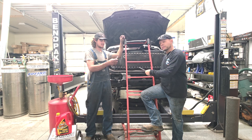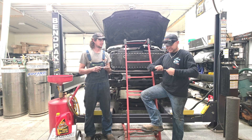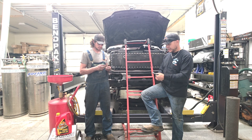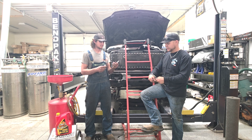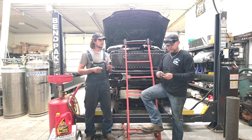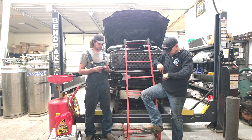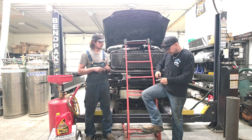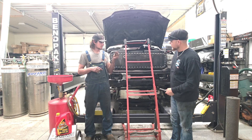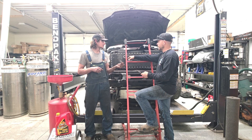Essentially, John figured out the tolerances inside the oil rail to not have to use an O-ring. He sends out some Loctite with these and suggests putting a small amount where your O-rings would go — right here and right here at the bottom. You can use Loctite and torque to OEM specs. That replaces the dummy plug. What this portion does is replace the top half of your standpipe. With your oil rail off, lube up and install the bottom half. Install this, put your oil rail on, and slide this down inside of there.